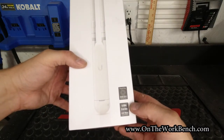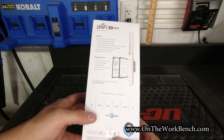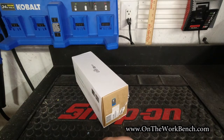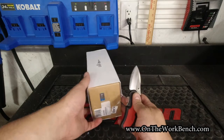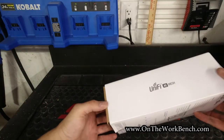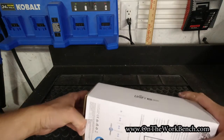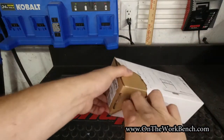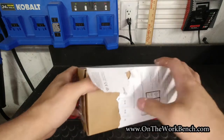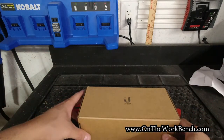It's a plug-and-play mesh network on the 5 GHz or 2.4 GHz — so it's dual band — and it gives you a few options. One thing I do have to preface: in order to effectively use this, you will need another UniFi device on your network that this can extend to that is also dual band. If you have an older Ubiquity device that is single band, it will not work as effectively. However, this can be used as a standalone access point, in which case you'll need to install the UniFi controller software on one of your computers, or you can buy the dedicated cloud key and plug it into your router.